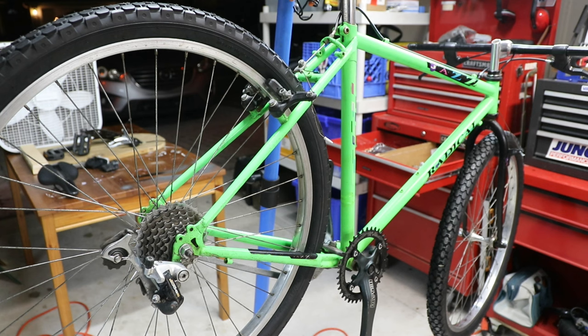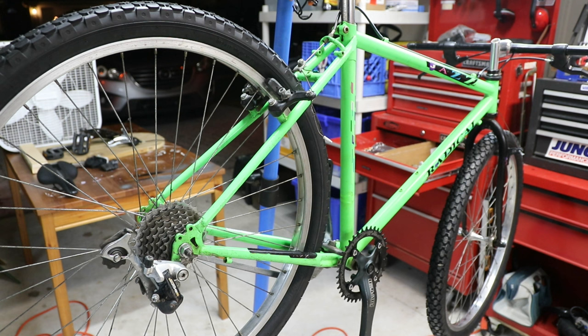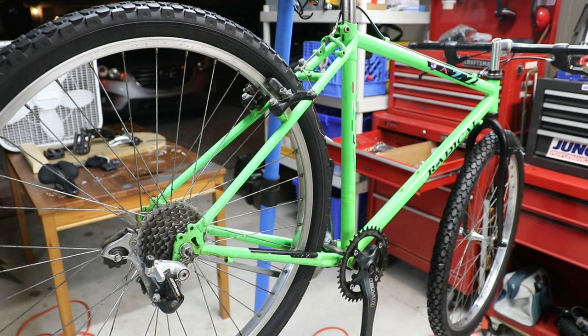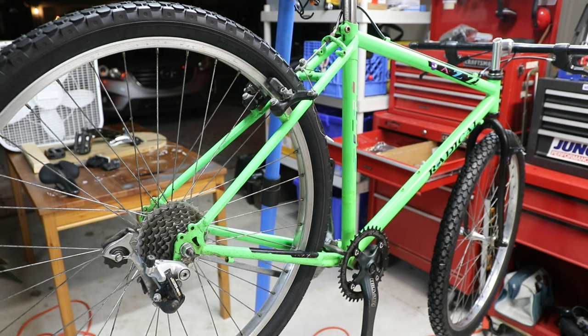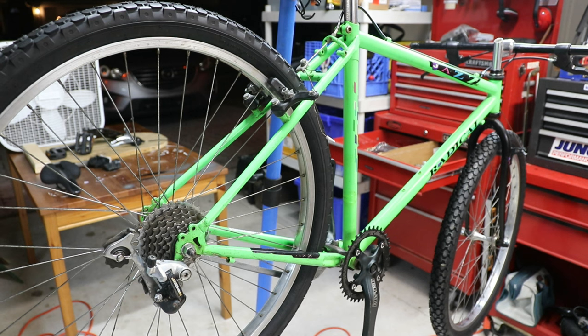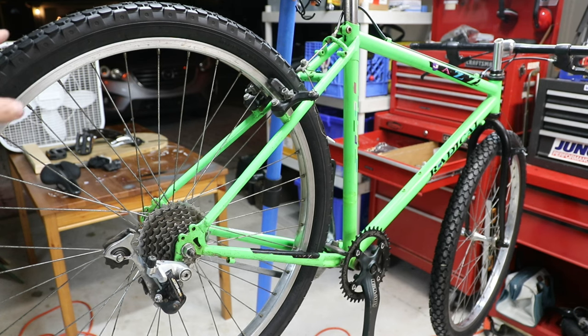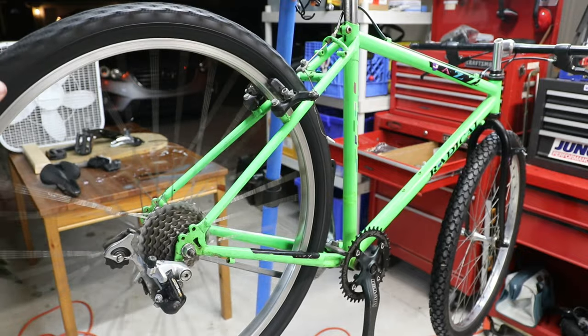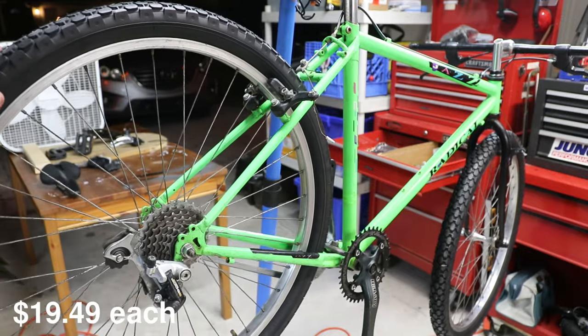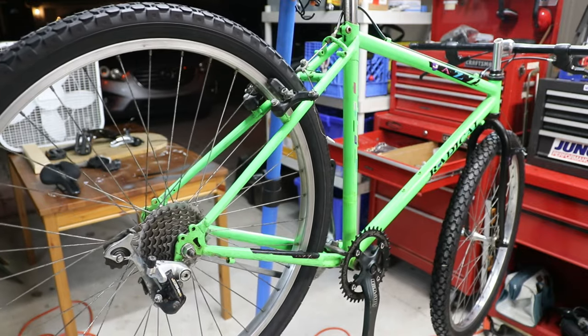So I just thought I'd warn anybody watching this: if you ever take your axle out, make sure you pay attention to which way you take it out and don't rotate it, because that can throw off the center line of your whole hub. Anyway, the bike itself is looking really good now. I'm getting kind of excited about it. I still need to connect the shifter up and put a new saddle on, but other than that, it's coming out pretty good, and I am actually really digging these tires. I obviously haven't ridden on them, so I can't say too much about them, but I'm sure they'll be fine. These Temu tires look really good on this bike. I think it's a great match.